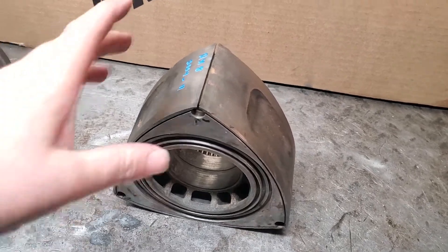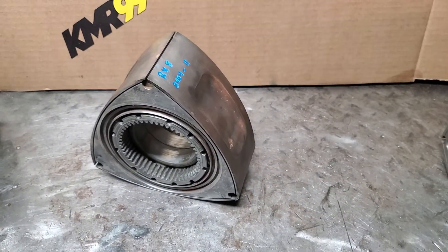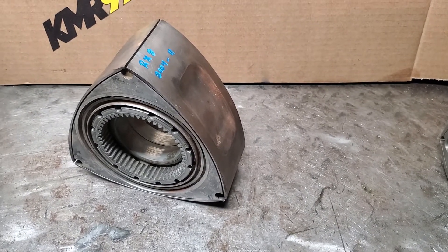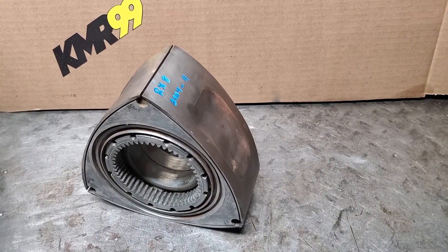We built e-production motors, streetcar motors, SCCA motors, lots of variations. And usually if you're looking for horsepower and response and you're dealing with naturally aspirated, that compression makes a difference. So generally, we're always recommending the Series 5 naturally aspirated rotors.